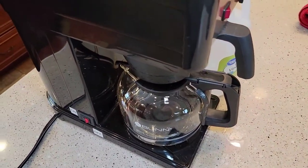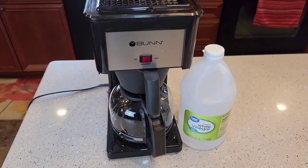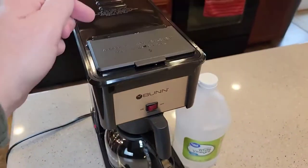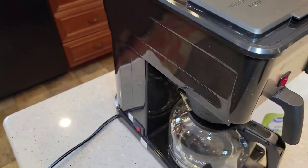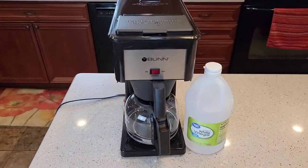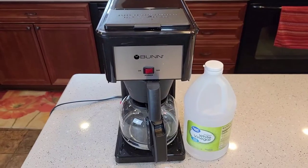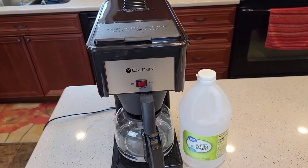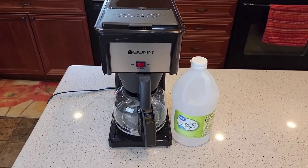You shouldn't have any lingering vinegar taste — that vinegar can kind of linger in there if you don't rinse it well enough. So it's been about another 15 minutes. That water heated up back here and I've got my switch on. I'm going to put the lid down and that's going to run another fresh water rinse with the heating element on. I hope this video helped — this was for the Bunn Speed Brew coffee maker. The newer one looks a little bit different than this, but it has the exact same instructions — they've changed the look a little bit, but you can use it on the new Speed Brew they're making. Please like and subscribe, and thank you for watching.